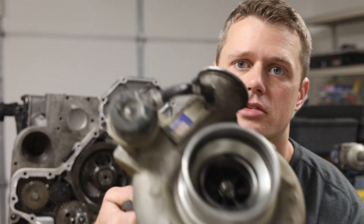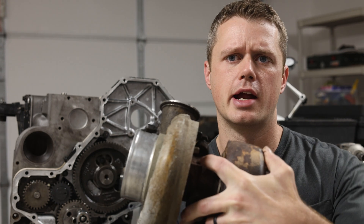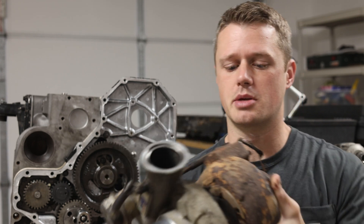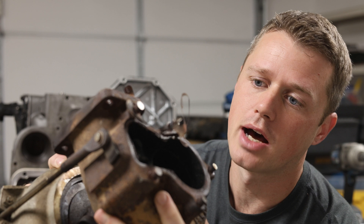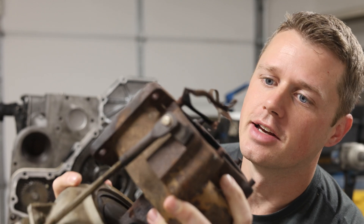We're not going to be using the turbo that came with this engine — it was a non-intercooled turbo that just goes straight to the intake with a charge pipe. We have picked up this HX35 turbo off a 24-valve Cummins, and this is going to make a lot more power — it moves a lot more air. You can see the passage through the compressor is quite a bit more robust. This is going to be a lot better option for this build. You have to run different AN fitting lines going to your oil filter housing. This is externally wastegated. But we do have an issue where the previous owner just lopped off all of the studs, so we're going to have to use a torch or weld nuts onto the back and figure out a solution for mounting this on the stock manifold.